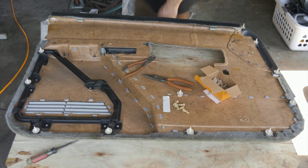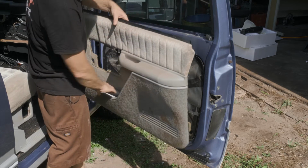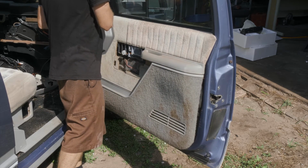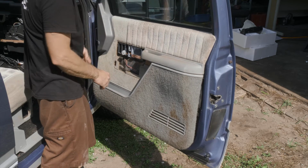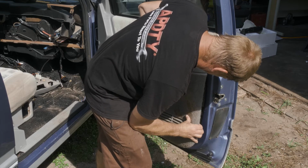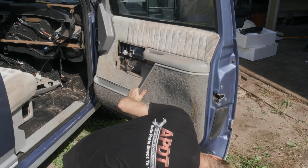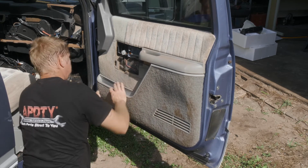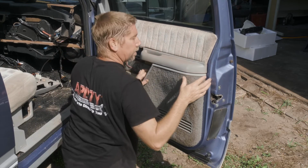All right, so now we're ready to reinstall our door panel. All right, so we got all of our push pins out. We'll go ahead and put our channel back in our door here. All right, so I just want to look around and make sure they're all lining up with the holes, and they just push right in. Same here. Make sure everybody's lining up. All the way along the bottom. All right, so now we have our door panel all attached by our interior clips.